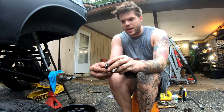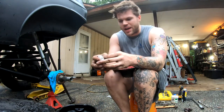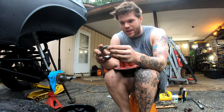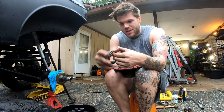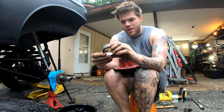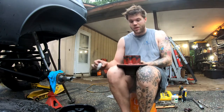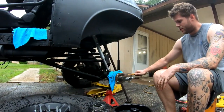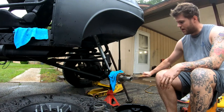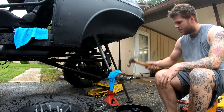This wheel bearing, you can check it out. You can just drop it on the ground, you know, ding it up, try and make it as bad as possible before you put it back in your nice new disc brake conversion, but everything seems fine in it. All the rollers are there. Just gonna pack this one as well when we get to packing and reinstall. I almost forgot, you gotta take these wheel studs out because you don't need them anymore for the disc brakes. Done.